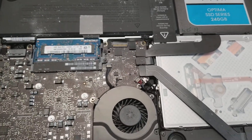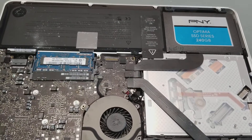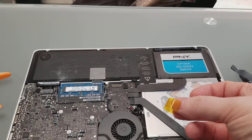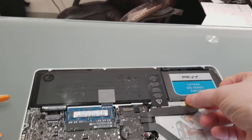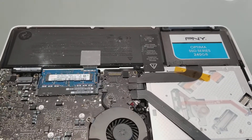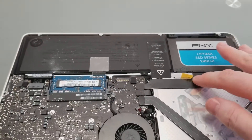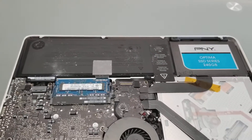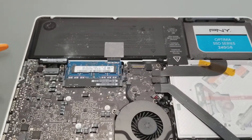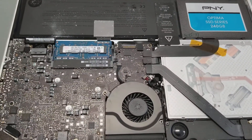So not a very good design by Mac. There is a fix that could prolong the life — I don't know if it will permanently fix it — but there is this incredible product called Kapton tape. If you put it on devices or places where it flexes, it does two jobs: it's incredibly tough so it won't rub through, and it holds cables, flex cables, or wires in place very well. In older iMacs, Apple used quite a few pieces of Kapton tape.